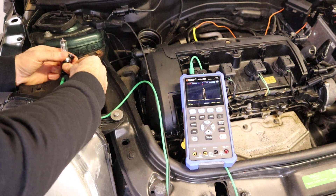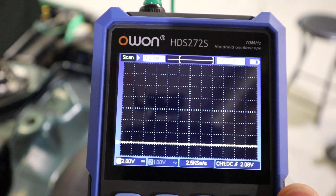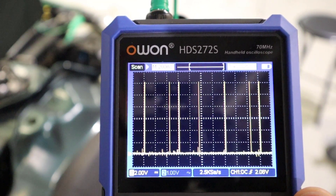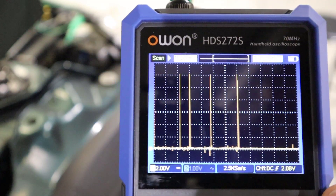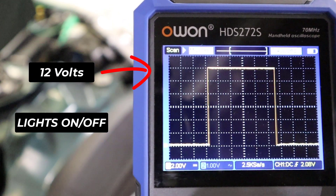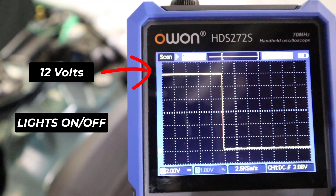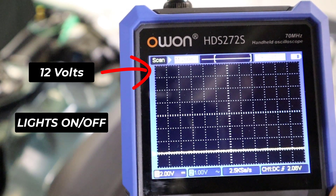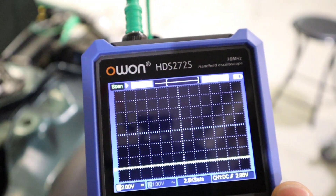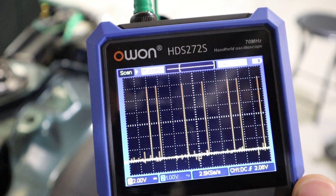What we'll do here is take this bulb out — so there's now a fault on this circuit. If we then turn on that light circuit, we can see that we get those pulses. On this circuit it's worked out that it's only an open circuit, so it hasn't turned that line off. Some vehicles might turn that line off — if it does that, check the line, turn the ignition off and back on again, and you're looking for those cold bulb monitoring pulses to come up.